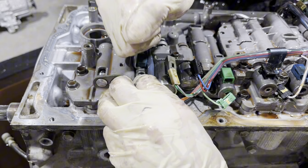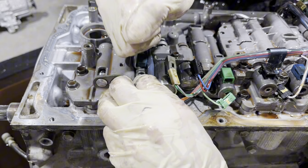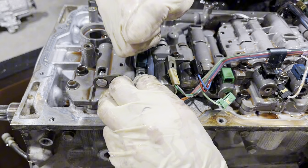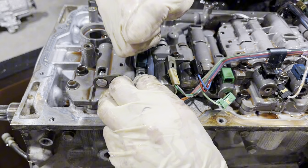If you have a Lexus like an A760 or A761, they usually have the one temperature sensor style. So you can use an AB60 valve body on them, but what you have to do is either find an extra sensor and plug it in there along with its bracket that holds it down, or you can hammer in a 3/8 cup plug - which is a pretty common item in transmission shops, related to a lot of GM stuff. Your rebuild kit will come with 3/8 cup plugs - it's for a parking linkage and you never end up using them when you do those transmissions, so you typically will have a bunch of them laying around. Now I just have to get the wiring harness out of the way.